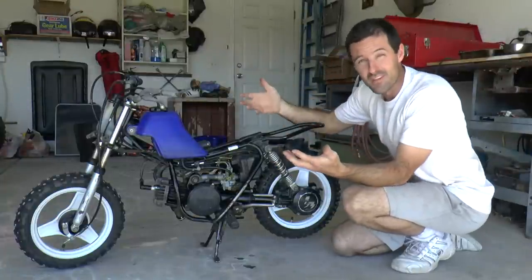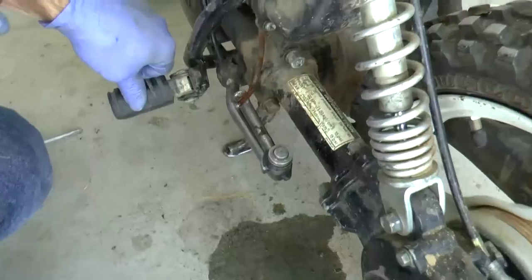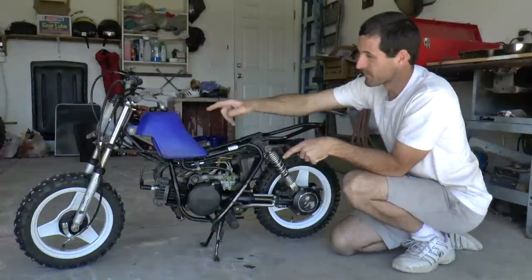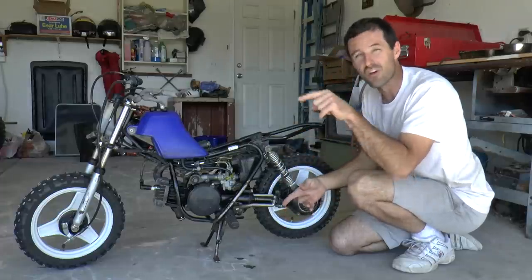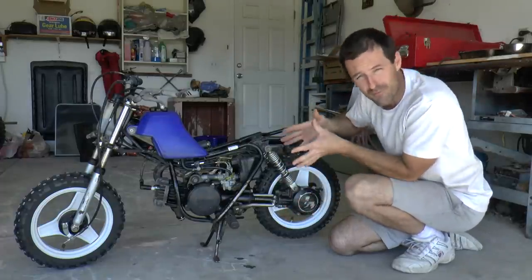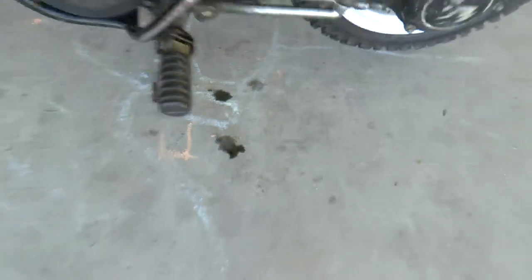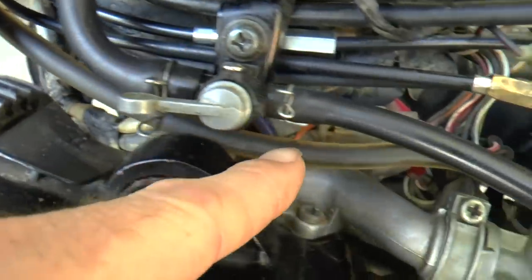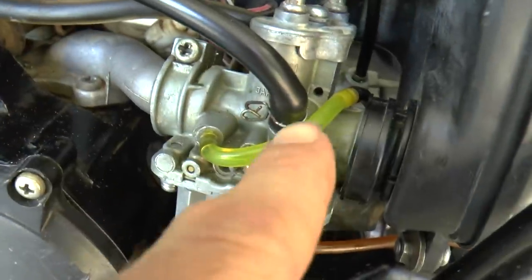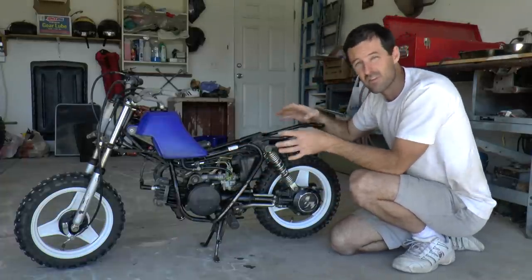Time for a test start — I want to see if we did any good with some of these repairs. I'm watching a few things specifically. When we began, the carburetor leaked fuel from the overflow, but I think that problem is solved. I put some mixed gas in the tank, turned on the valve, and there's no gas on the ground. But there are some oil spots on the cement. When I put oil in the tank, the fuel hose that I used as an oil line started leaking down at the pump. I replaced it with some clear tubing that I had and I think it's fixed. As the engine's running, I want to monitor this line — if oil gets to this point, I'll be confident that the injection system works. I also want to pay attention to how the engine runs in general: does it rev, does it idle?